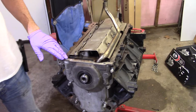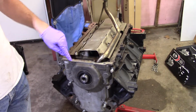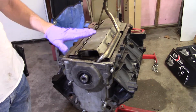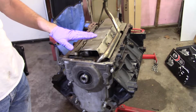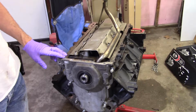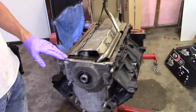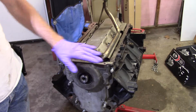And the reason why is because the oil pan is also aluminum, and it actually has two bolts in each one of the ends. If you have this too far up or too far down, it'll throw everything off. And the tighter you try to get it, especially if it happens to leak and you're up there trying to retighten it, you'll end up breaking something, because these bolts are little. It'll ruin a perfectly good day. So line them up to begin with.